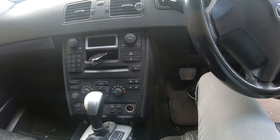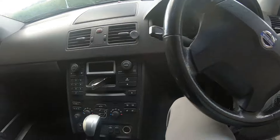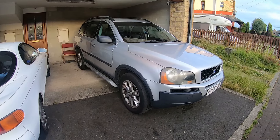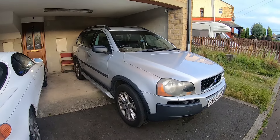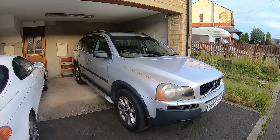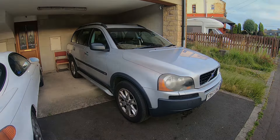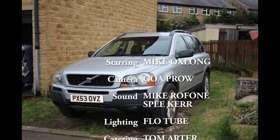I read up on the adjustment - it says one notch. So release it, one notch, then adjust the cable from there and it should all be good. I've got it all buttoned up and tested it out - the parking brake is working like it was before. That was quite an easy fix, no parts required. As Ivan would say on Pine Hollow Auto Diagnostics - confirmed fix. Hope you enjoyed this video, thanks for watching, and I'll see thee.